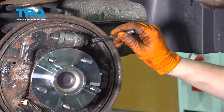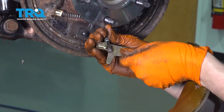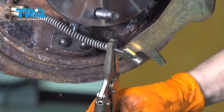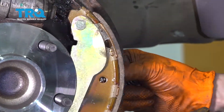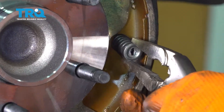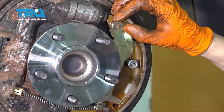Make sure you grab the right brake shoe — the parking brake lever has to sit on the front of it, not the back side. Pull back on the spring and reattach the cable onto the lever. Slide the parking brake shoe in using locking pliers. Take your pin, put it through the backing plate and through the shoe. Put the spring back on, bring the shoe where it needs to be, line up the pin with the cap, press it on, and rotate it 90 degrees to lock it. This is now secured.